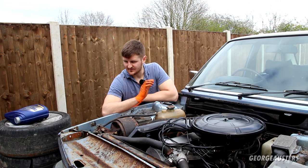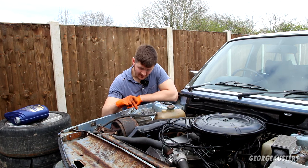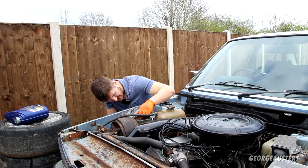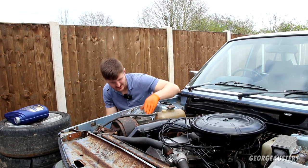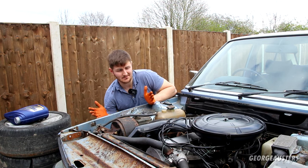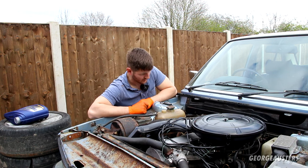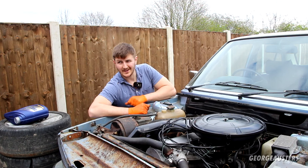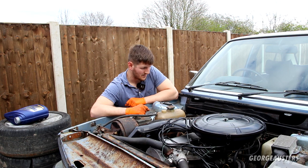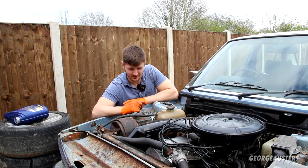I'm going to proceed and pay some attention to the brakes. There's still the original brake fluid in here and it's below the minimum — we do have some fresh brake fluid though. Is there a leak? These steel pipes are all 45 years old and most are probably original, so chances are we'll come across some leaks. I'm going to get the car up in the air and try to bleed all four brake calipers and see how that goes.